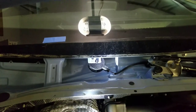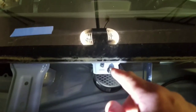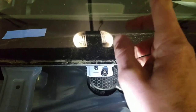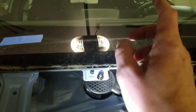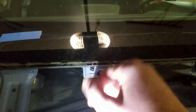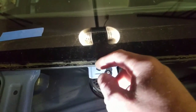Alright, we got all that off and it exposes everything under here. Here's the culprit - this is your sound generator. I do believe it shakes everything inside because it's mounted right underneath the windshield. I think those vibrations from the engine go through here and rattle all the plastic on your dash, possibly your rear view mirror, and for sure my garage door opener. I could probably tape it up, but I don't wanna do that - I'm just gonna go ahead and remove this guy and discontinue all that rattling inside. And as you can see, it is mounted right up underneath your windshield, so that vibration's going up through there and rattling everything.